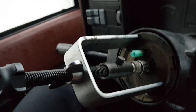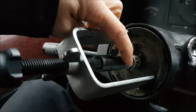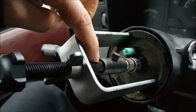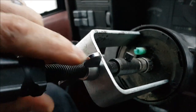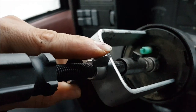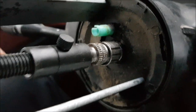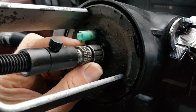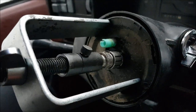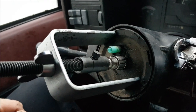Okay, so here we are. We have the compressor mounted in here. This shaft threads onto the end of your steering spindle, and this part just spins on the end of this so you can crank it and it will thread in. Once you get that threaded on, the wing nut tightens down the outer part and it compresses this down. You want to compress it down until you can see that lock groove right there where the ring goes. Then you use a screwdriver or two and shove the ring all the way down onto that spot — I'm going to need two hands for that so I won't be able to record that part.